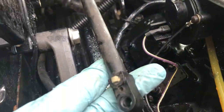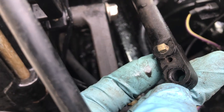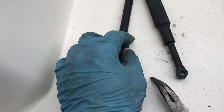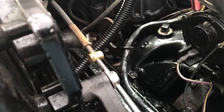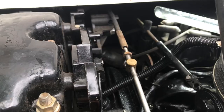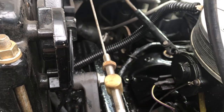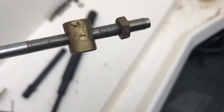Now I'll hold some pliers on there, take that jam nut right there, and get that loosened. First, these little square things here hold the cable in, so I'll loosen that with a crescent wrench, then loosen that and hopefully unscrew this whole thing off of there. It came off — once I loosened those it released from the cable and slid right off. Now just undo that jam nut and unscrew this whole thing. As advertised, just loosen the jam nut and turn it and it unscrews. The good news is the distance there is the adjustment — I didn't mess with that at all. I just loosened the jam nut and unscrewed the whole assembly.